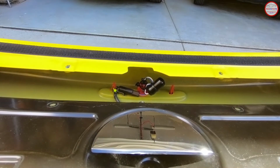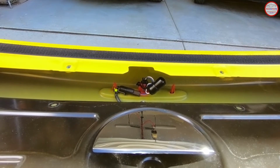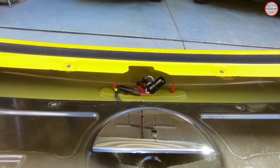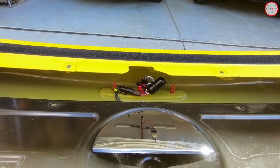Now we're taking a look inside the tailgate of the SSR, pointing at the third brake light area. I've got the wiring harness and BLP-1 SSR and third brake light all tied together here, and let's point them out individually. So let's use the laser pointer here. That's the input wiring harness from the vehicle right here, and then the BLP connects directly into that. And here's the BLP-1 SSR unit, and then it has a wiring pigtail that comes out and goes straight into the brake light.